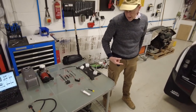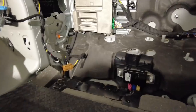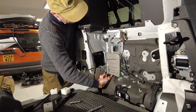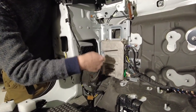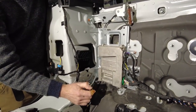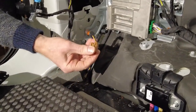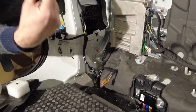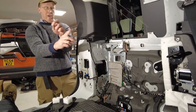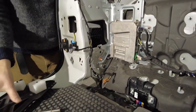Let's have a look in the bag of goodies. Let me run you through the basic story of what we've got to do. The wiring loom is going to go up behind here so we've got the compressor connections at the top. This is where we've removed the power outlet when we took the panel. We are going to remove this connector housing and reinsert it into the new one. That's why you must disconnect your battery — because you will have a live earth and power ready.